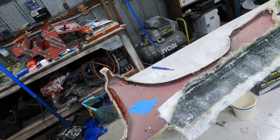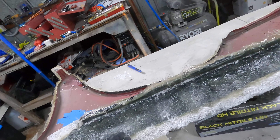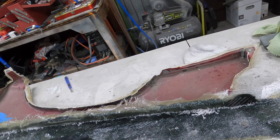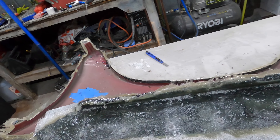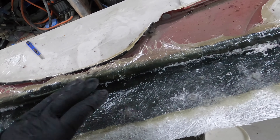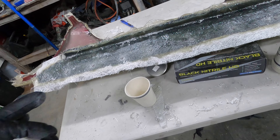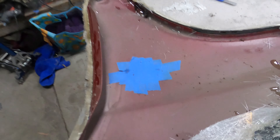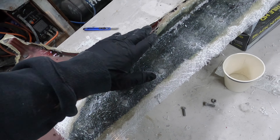Alright, we're finally back on this - bit of a busy weekend with kids' sports and parties. I went ahead and drilled a hole about every 100mm and put M6 bolts in. Haven't tightened them up yet, so what I'm going to do is tighten them up, get the angle grinder and cut a nice, clean straight line. I'll trim up this top section and instead of rushing this and trying to get it out quick, I'll redo that top because it's not the best. Trim that up and lay down some more fiberglass - make sure it's good, you don't want to stuff this up after five years.